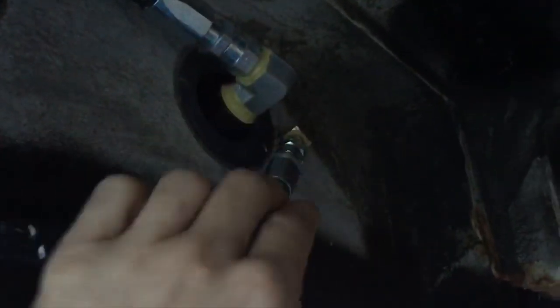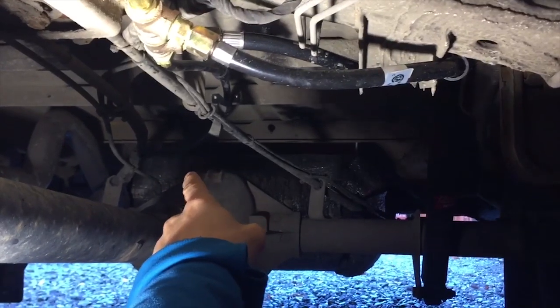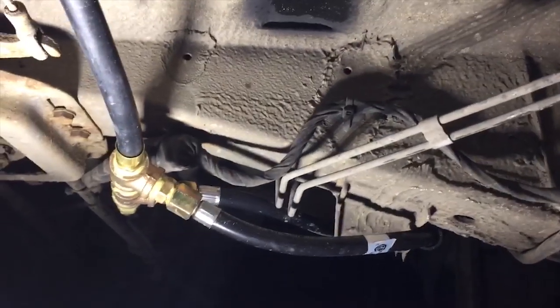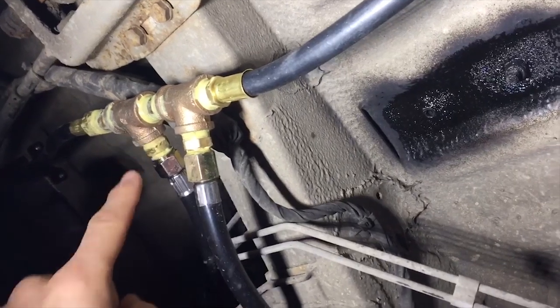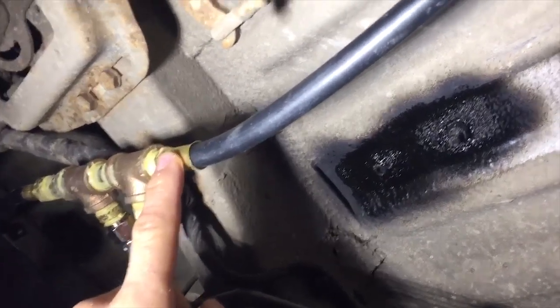Underneath the van we have the back of the remote fill kit — here's our bleed hose and our gas fill-in hose, which wraps up and under and ties in out of the way. That runs into the top two connection points. We have our first gas hose coming up and leading to a junction — basically a bunch of branch connectors which allows the gas to feed in and then go off in different directions. The first point is our furnace, the second is our on-demand water heater, and the third point is the gas oven that comes up and over and fires up into the base.